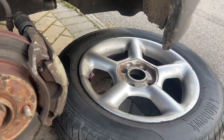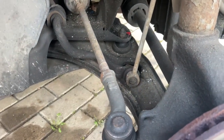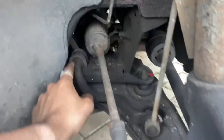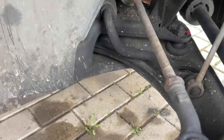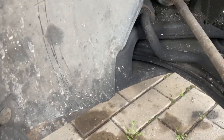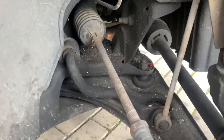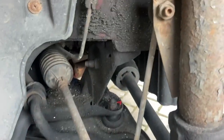Now you've got your wheel off, this is your anti-roll bar here, this is your drop link - they tend to cause a bit of noise when they go. But the other thing that can also cause noise is the bushes which are back here, and they are what bolts the anti-roll bar down to the car. As you can see mine has worn because you can see where it's been wearing against the edge. The other side which I did yesterday was rattling quite a lot. If I get a lever under the anti-roll bar and wiggle it - it's not the ideal bar to be jabbing in places - on the other side that was moving around like crazy and it was causing a lot of rattle, very much like a drop link would. But if you've done your drop links, which I have recently, and mine have no play - I know they look a bit scabby but yeah, road salt.